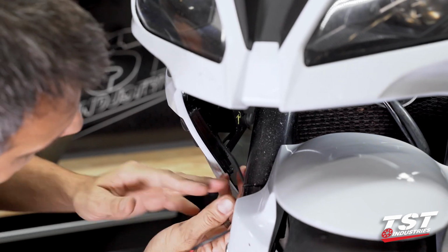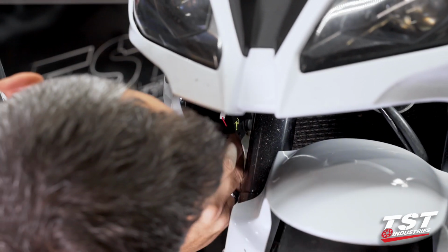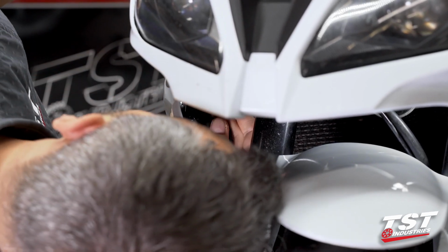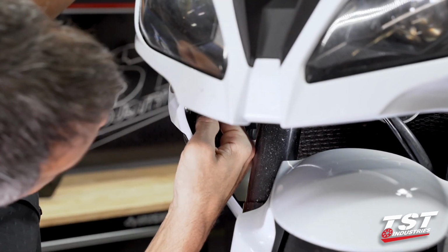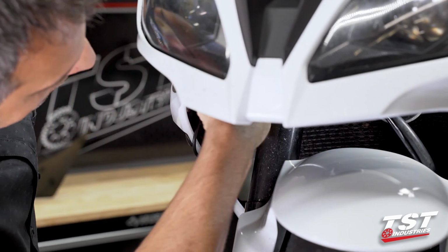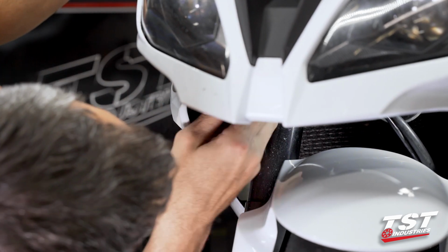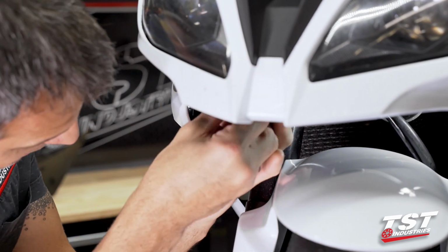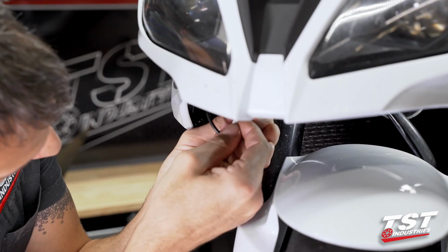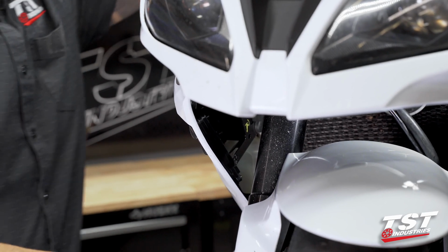Everything's bottomed out, so now we can snake this wire back in through that little hole in the foam piece that we found in the disassembly. Once that gets to the top, we'll just connect it to that gray connector we found in a prior step. And now we can actually power up the bike and test it.